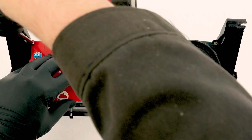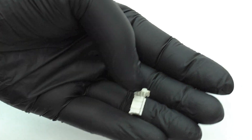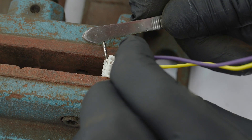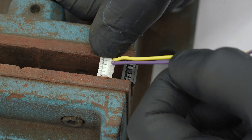Take note of the colors on your GoWesty PCB board. If they are white, you are going to need to use the provided white connectors and re-pin the harnesses. It's critical that when you're re-pinning these harnesses, you use one wire at a time so that the wire orientation doesn't get mixed up.